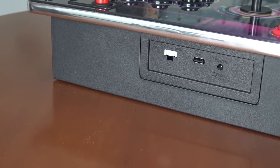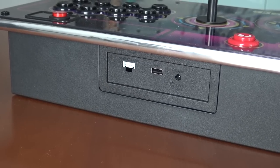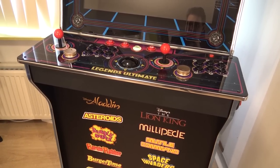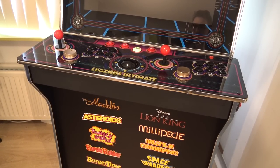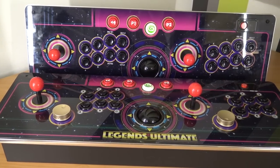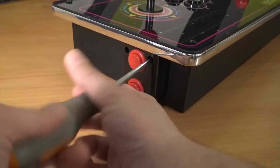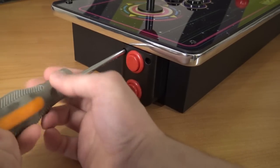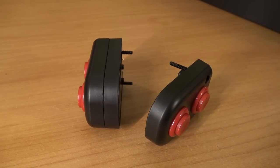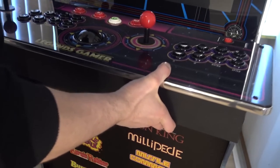With the original control board from the arcade machine we get some extra connections, because we can do some pretty clever stuff — we can use the control panel inside an arcade machine. The arcade machine is hot-swappable, so if you want an 8-button configuration you can use your ProStick inside the arcade machine. The button layout is slightly different compared to the other version, and the arcade machine has spinners that the ProStick doesn't. To do this, you need to remove the side flipper buttons and remove the extra plastic plate attached to the ProStick; otherwise you can't install it in the arcade machine.